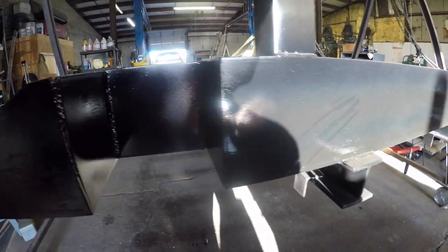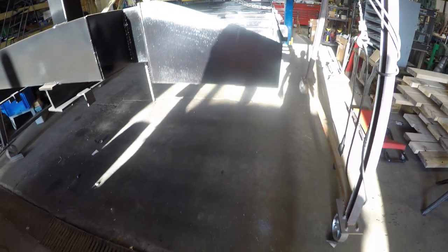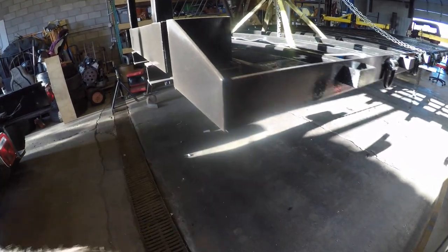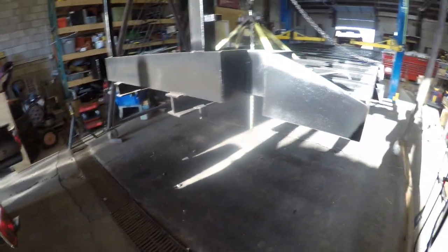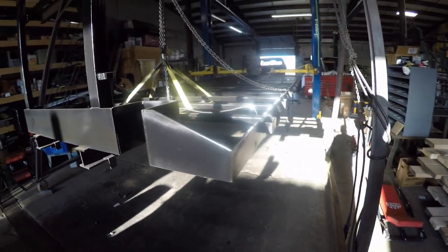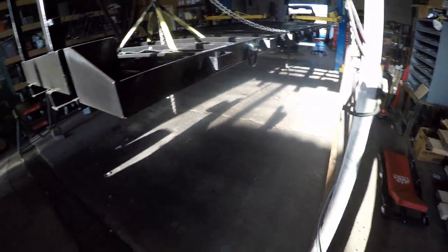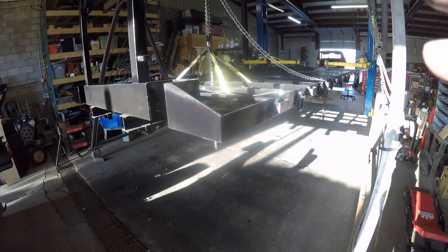This is, yeah, well, there's a lot of dust on it. I painted over it with that polyurethane paint so that it would be UV protected. I did the other side too. I haven't done the side rails. I'm going to be more meticulous with the side rails and stuff, because I just wanted to get a coat of paint over the POR 15, because the POR 15 isn't UV protected, so I wanted to get a coat over that where I couldn't get to it. And once this thing goes back on, I wouldn't be able to get to the backside of any of this. Not that it's going to get that much sunlight, but it will get some sunlight, and I don't want the POR 15 to be exposed to the sunlight. But anyways, I'll bring you back.